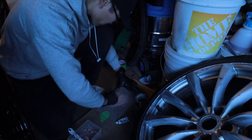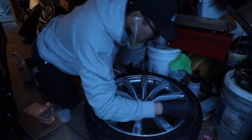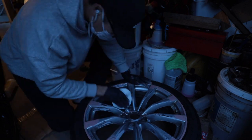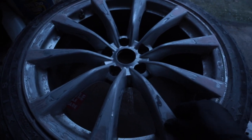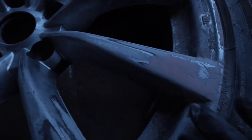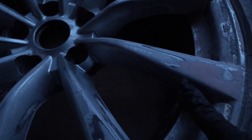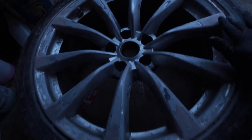Got some wax paper here — I'm just gonna mix the bondo on here and then apply it. I'm gonna start with the 180 grit and then just go up from there. After sanding it down, it doesn't look too bad actually. There are some spots I'm gonna have to go over again with bondo — like this part right here you can still feel the scratch — but other than that it's pretty smooth.